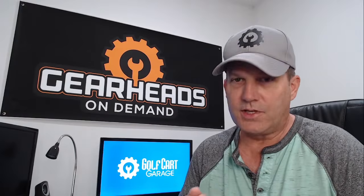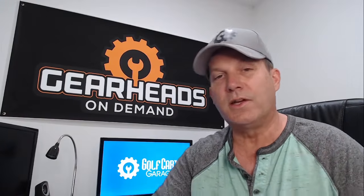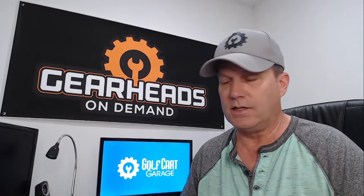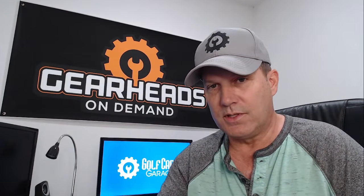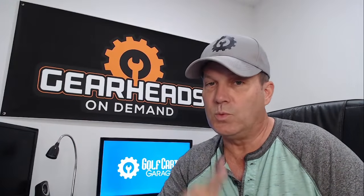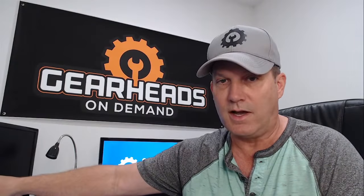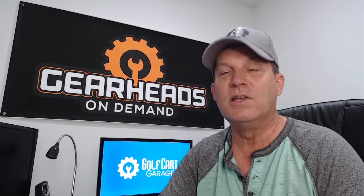What you're telling me is that you plug your charger in, and you've got the older type charger with the big heavy transformer in it, and there's a relay inside of it. You plug it in, there's a few seconds delay, and you hear a click, but the needle doesn't move. Well, I can tell you one way to duplicate that exact scenario, and that would be if your charger was plugged into the wall and your outlet wasn't hot. It would do the exact same thing. So let's clear that up. If I was you, I'd clear that up first.